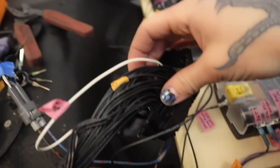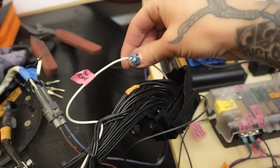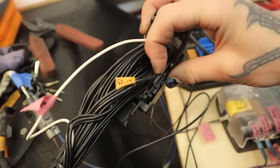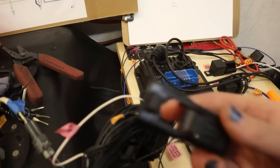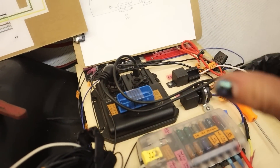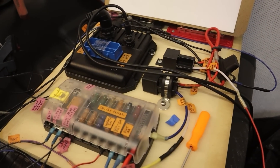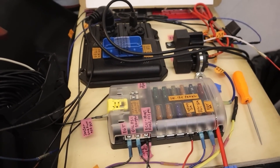I just finished wiring in the other two sensors that did not come with the Drift Motion patch harness because I was not committed to those at the time. So now I've got oil temperature which is in pin 40, and our EGT which is now in pin 75. We've got those two additional sensors. Now I'm going to put this cap back on, plug her in, and fire up the computer to just make sure all of our sensors are getting signal and I wired everything correctly — just do our final checks before we waste the tuner's time.